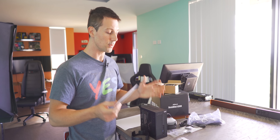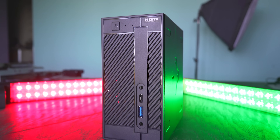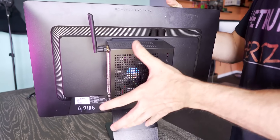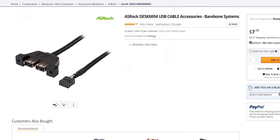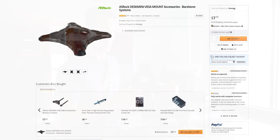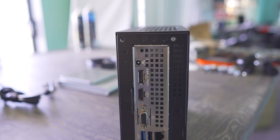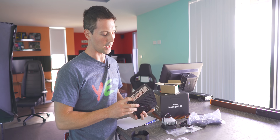It's a very small unit measuring 154mm by 155mm by 80mm depth - comes in smaller than my hand. At the back it's got the option to VESA mount it to a monitor or a wall. That accessory isn't included and you can buy it for eight bucks, which is very cheap. You can also get a USB 2 extension for another $8. At the front you get USB Type-C, USB 3.1, onboard audio out and mic jack, and at the rear there's a power button, DisplayPort 1.2, HDMI 1.4, VGA out, a USB 3.1 Type-A, and a Realtek 1000 megabits per second NIC.